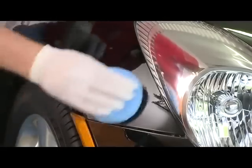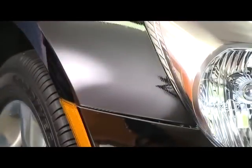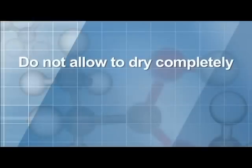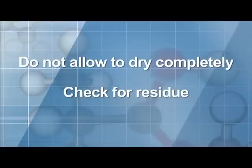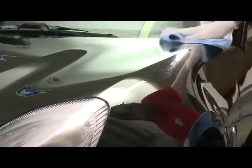To correct a Glass Coat misapplication, or any drips, fingerprints, streaks, or smudges, reapply Glass Coat within one hour and immediately level the product with a clean, dry microfiber towel. Now depending on the temperature, the Glass Coat may polymerize very quickly in extremely hot temperatures. We suggest only applying the product to one panel at a time. Do not allow it to dry completely. Now that we have completely applied Simonize Glass Coat, we need to make sure there is no leftover residue. If there is, and it can't be leveled easily, just reapply Glass Coat to that area and re-level it.